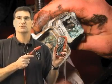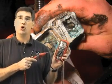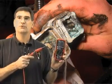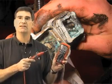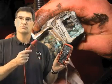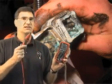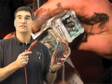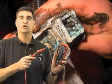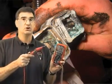What did LoadPro leads make it possible to do? LoadPro makes it possible to actually ohm out the entire circuit from the load all the way back to the battery, positive to negative, instantly, because pushing this button forces current to flow, which is exactly what an ohm meter does. The difference is that the system you're working on has a lot more horsepower than that little 3-volt battery in your meter.